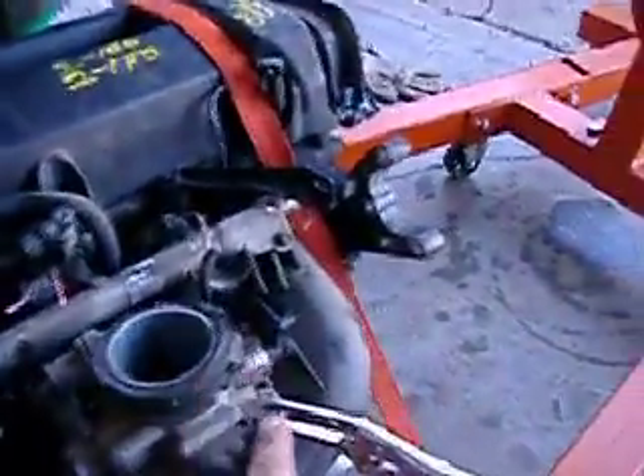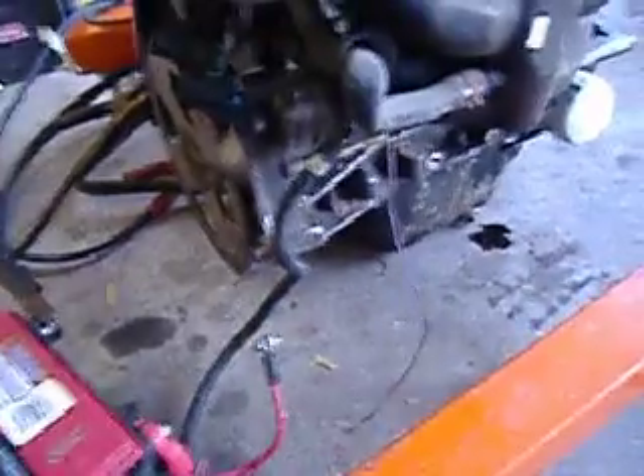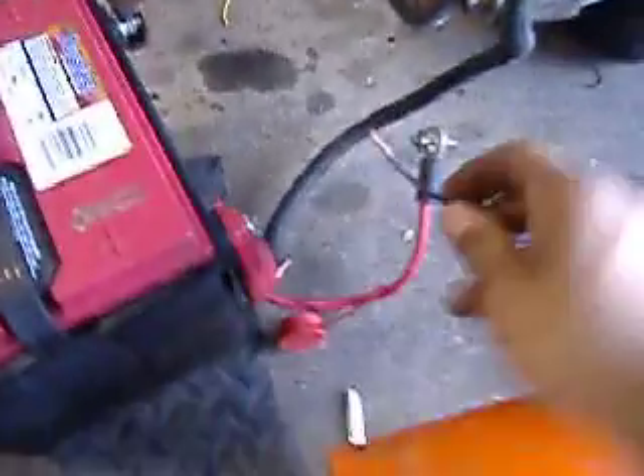I've got the throttle held wide open right here. I've got it hooked up to a car battery and a regular positive lead out of another car hooked up to the starter like it normally would be. You want a pretty beefy wire going from your positive to the starter — if you only have a thin wire, beef it up by twisting five or six different pieces together. I've got the negative hooked up with a jumper cable to the block. We're going to use this wire here, touch it to the positive, and that will engage our starter.